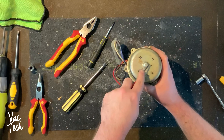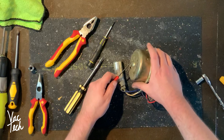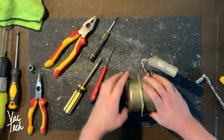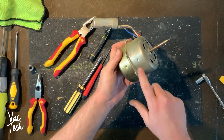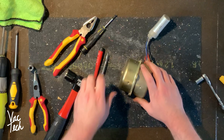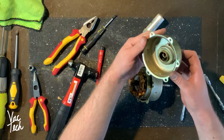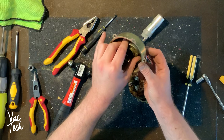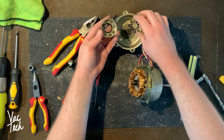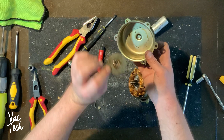I'm trying to do this without stabbing myself. I think this thing was probably kept in a garage for years. This is a capacitor - a giant old capacitor. I'm trying to pry away from myself, not towards myself. There are these dots here and I really don't know if I can take this apart further but I'm going to try. It's just split open right on this side and it is coming apart. Here's your rear bearing - that is really gunked up. This is a bearing retainer so I can lift that out, and then here's your rear motor bearing.